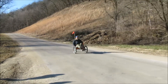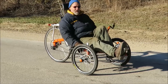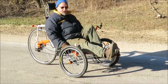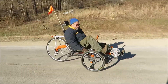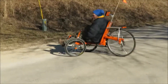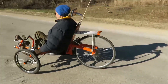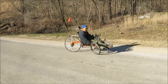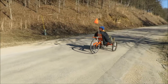I'm going to hit the brakes — see how the rear wheel skids? It's because I don't have enough rear traction on it. I should have had the front booms even three or four inches forward and it would solve that problem — so that was a mistake, but we'll live with it. I also need to put different rubber on the front brake; the rubber is too soft for the front disc brakes and it doesn't grab them the way it should. I think if I can get the right kind of rubber it'll help with the front ones working better.